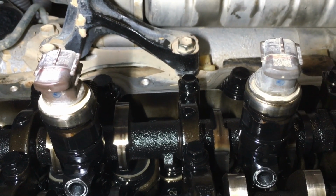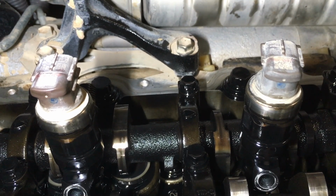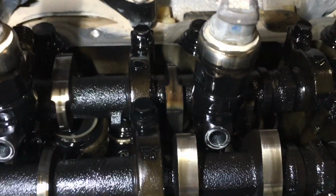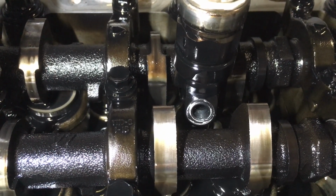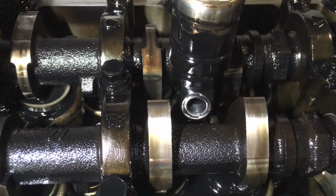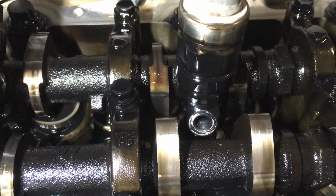I'm going to show you the whole process because I've been here sometimes getting these out for hours. It might look easier to twist it, but twisting it's one thing, getting it out's another. That's a whole other story. You need to be able to lever it upwards. So a big pry bar on that camshaft there, on that unmachined area, that raw cast area, levering upwards on the injector outlet side here. To be honest, you can have some big pry bars and they flex, and it's just really hard work getting them out.